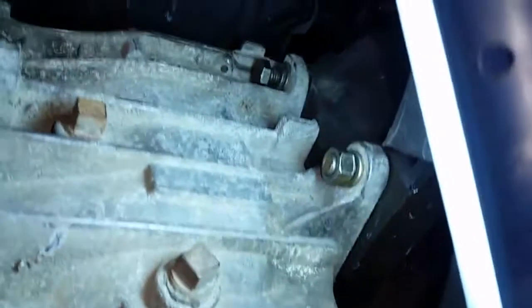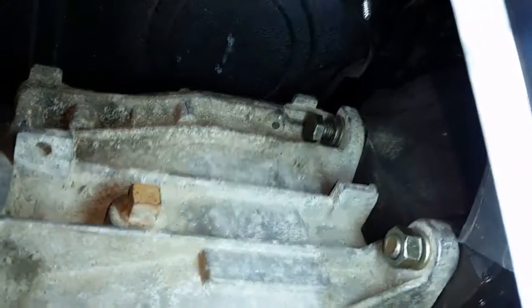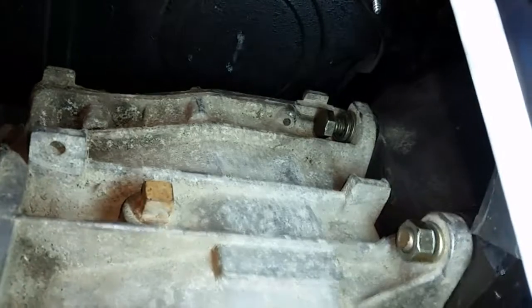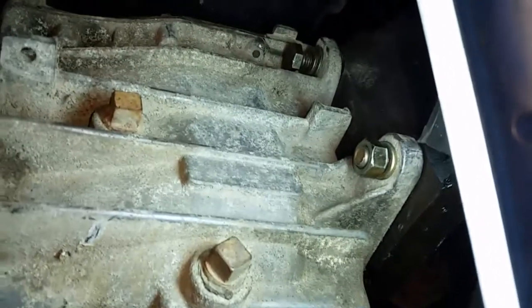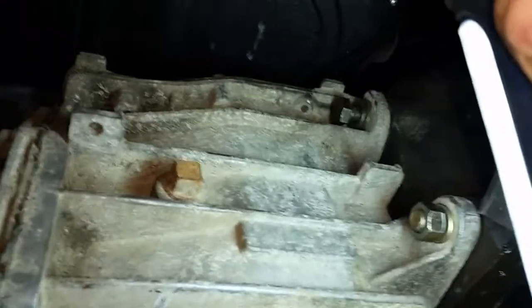So nothing binds in the back of the flywheel or the crank. Everything on these T5s, 86s, they bolt right up. All I had to do was ream the holes out a little bit. They would have been tight, so I just ran a 1/2 inch drill bit through them. No problem. Bolts right up.